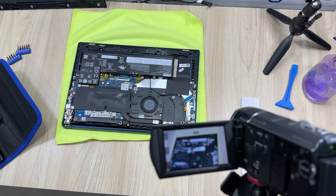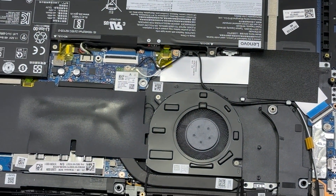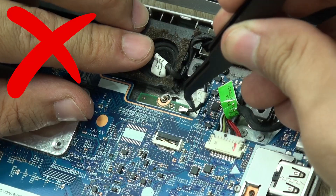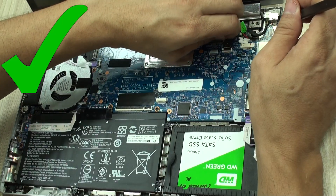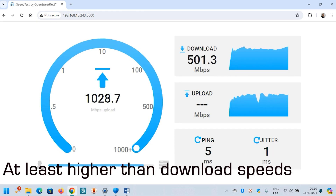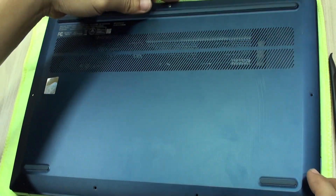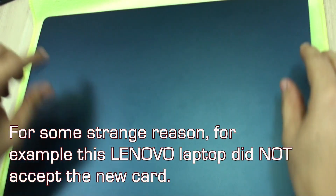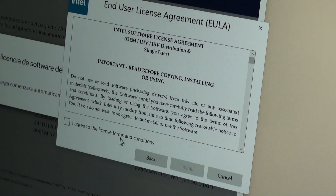As we always say, if you're in a hurry or need to have your laptop back at work soon, you shouldn't try this unless you're an experienced user. Take your time, as disassembling and putting back together your laptop may be a task of extreme care — discharging your static electricity, disconnecting the battery, not losing any screws, and not breaking any plastic parts. Putting it back together is much easier if you don't feel too confident. If it is the first time you open your laptop, try to document the task with your cell phone as close to the computer as you can — sort of what I'm doing right now. That was exactly what let me quickly find out I had made a mistake connecting the antenna to the secondary connector instead of the main connector.